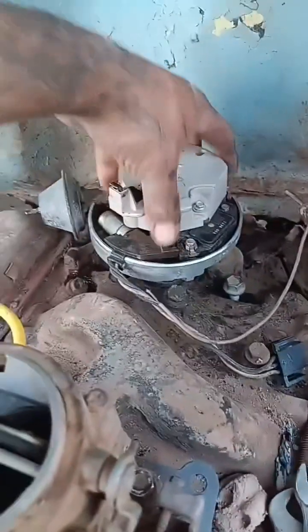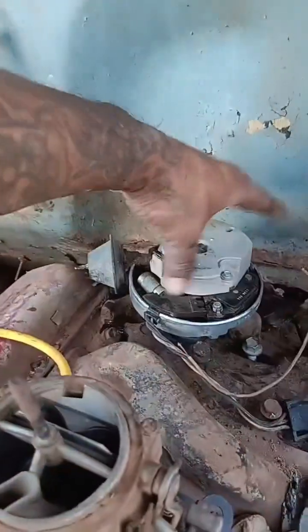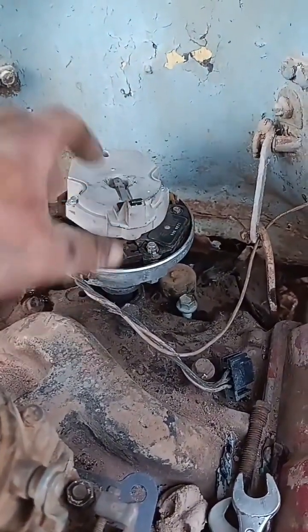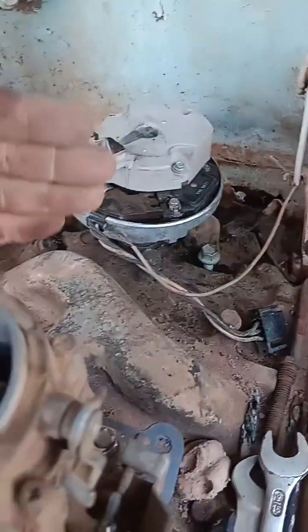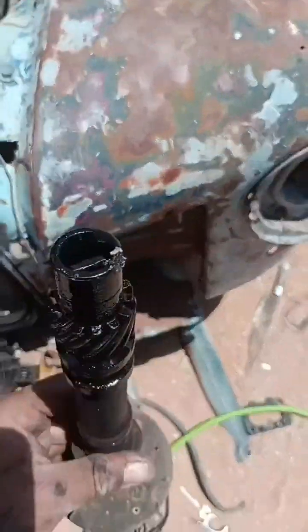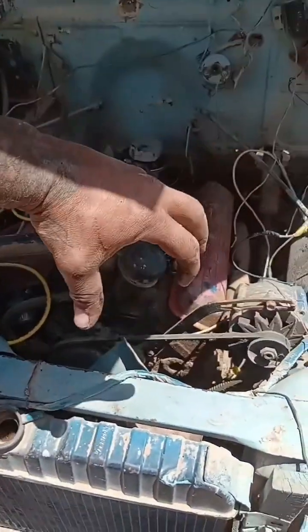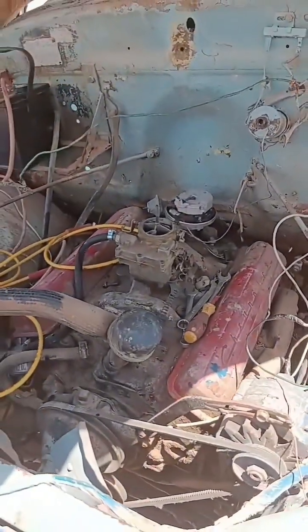So you can see this when you're gonna point it. If you want it to land here, you gotta start it about 30 degrees this way. So you see when you pull it up where it ends, where it starts right here, you gotta let it drop in. That way it can drop into the oil pump gear, which is the slot, and then the gears itself. Because not only does it have to line up on the gears, it has to line up with that shaft. You see that little slot? So it's a 180 to the teeth. So I always remember it goes in like this, and then down. So 30 degrees off where you want it to actually land. That's where people mess up.